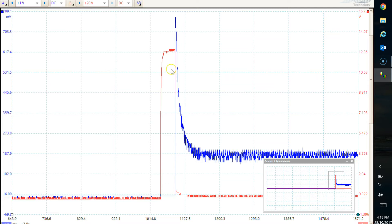Don't forget the fuel pump is a ground-switched circuit — the ECU puts it to ground. So basically, until it's put to ground, we should see battery voltage on that wire. This is the period of time where the ECU is having a little think — do I really want to start up the fuel pump? At this point here, it decides it will, which is a good thing. It puts that circuit to ground, so you'll see that this voltage then plummets basically almost to zero.